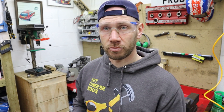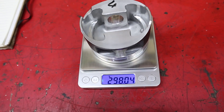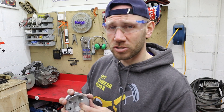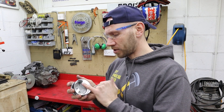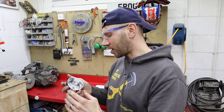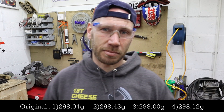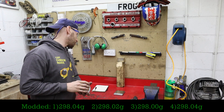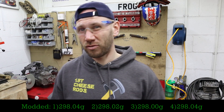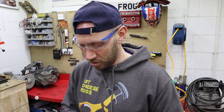And I've just got to take a little bit off number four now. So that's all the pistons done. I'm not going too wild with the science, to be honest, but making sure I take off material from the centre line of the piston, making sure I remove all the burrs, and that they all measure the same now. So now I've got 298.04, 298.02, 298 dead, 298.04 — or 298 to be honest. Really, really happy with that.